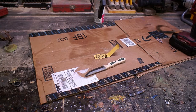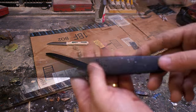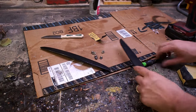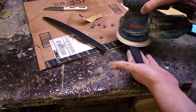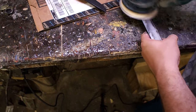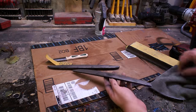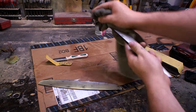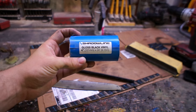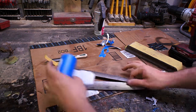I really wanted to start with some small pieces first, and these come off the car very easily so I could put them on my desk and work on them. I've used flat black chassis black to paint them before and it looked relatively well, but over the years they got a couple little dings and chips and weren't looking very good anymore. There are some hex heads, really easy to take off, and then I had to go back through and sand that off to make it a perfectly smooth surface, because you will see little imperfections through the vinyl.